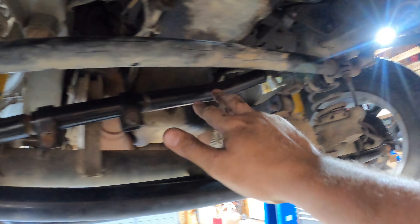Everything works flawlessly with both dampeners. I have no more steering wheel wander or wobble — it tightened everything up. Keep in mind, when it was wobbling, I think that was the original steering damper with 180,000-some miles on it. If you have death wobble, this is not necessarily a solution, more of a Band-Aid. Same with bump steer. Either way, I put the dual steering stabilizers on this 2004 Jeep Grand Cherokee WJ and it is working amazing. I don't regret it — it was worth the money, and I'll link them down below.